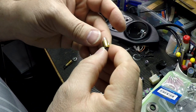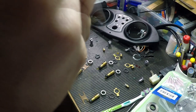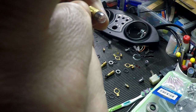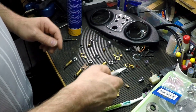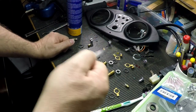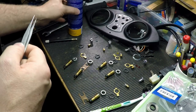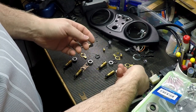One thing of interest: these are all the old bulbs, all the original bulbs in there, just in case someone wants to know what they are. 12 volt, 2 watt Osram bulbs — and these are available. Now of interest is the red light, the gen light. And the gen light on the Ducati is not like a gen light on other bikes, because it stays on — I wonder if this was done on purpose.